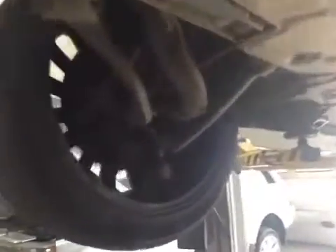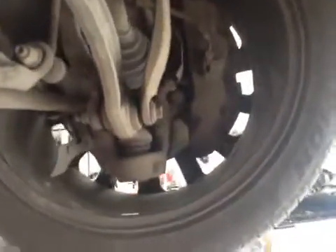Starting with the front brakes — the pads themselves are down to 1.5mm, so they do require changing. That's why I've marked the discs down as well. As you can see the shine up here, there's a large lip on the disc, and you can see the heavy grooves on the disc here. I do recommend changing those, as they will shorten the life of the new pads.